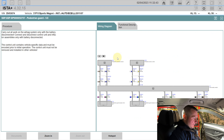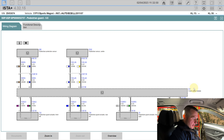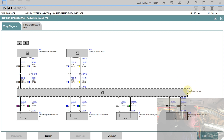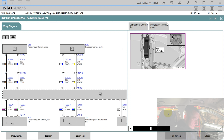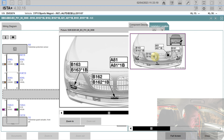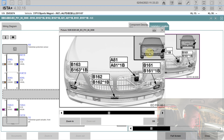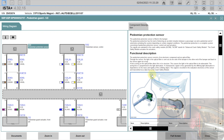For a better overview, here is the wiring diagram in full screen. You can see the crash safety module — the ACSM — and the four pyrotechnic cartridges below it, matching what we saw under the hood. Also under the bonnet are two sensors: one is sensor A68, and their locations are shown clearly on the diagram.